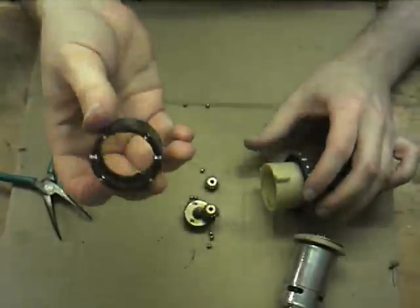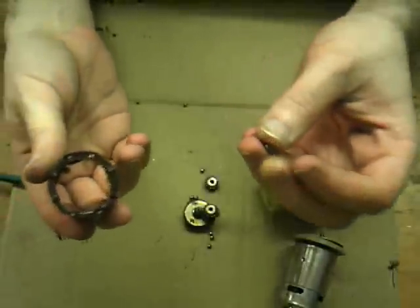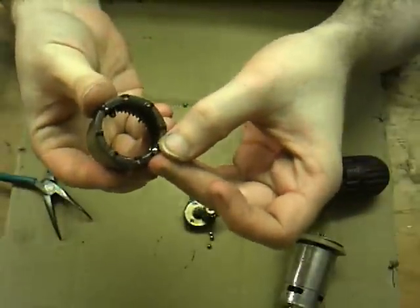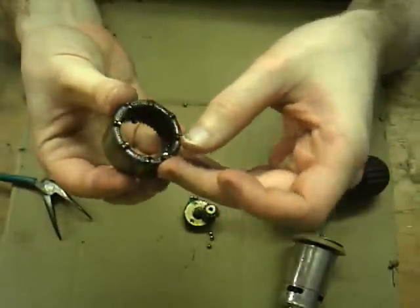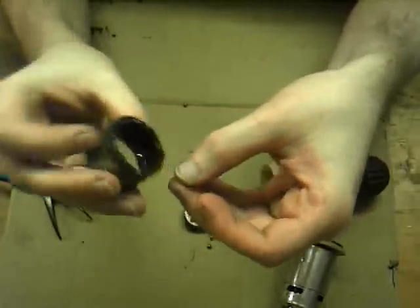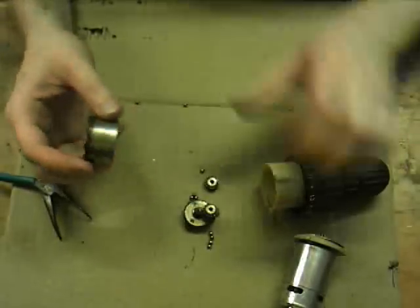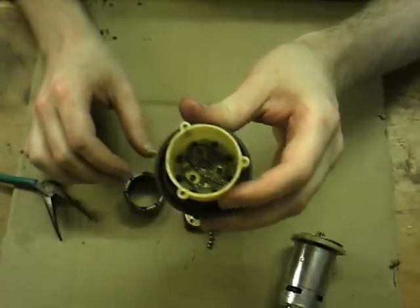But you can see on the annular gear these nubs, and what would happen was, of course, the main spring would press the ball bearing plate down onto the ball bearings, and they just sit there, pressed up against it, holding this locked in place like that, until sufficient force would just skip over them and skip and skip and start turning. And this is a very neat little system. Now you see the final stage carrier there.